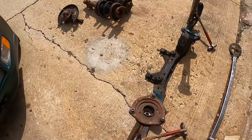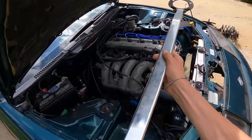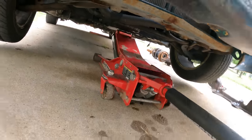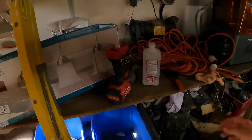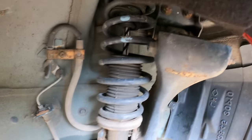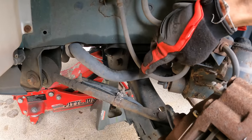Basically the whole point of making these jigs is to find out where the strut bar goes. I may even need to cut out some of the shock tower to match the stock geometry for the S chassis. We'll start by jacking it up, popping the wheels off, and taking off the Z suspension. The perks of this being a monster truck — jacking it up straight from the subframe. Now we can grab the impact that should be fully charged. We have the knuckle, the upper control arm, and the shock itself. We need to remove all of these as well as the stock tension arm, lower control arm, and possibly the sway bar.